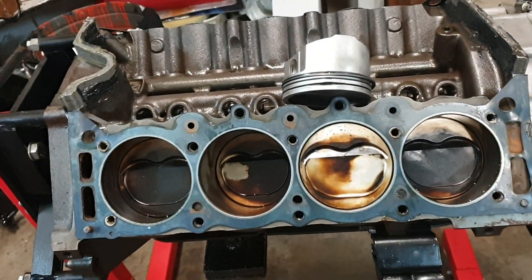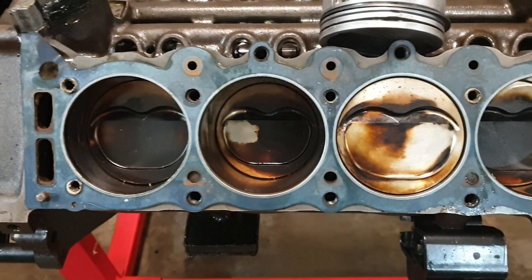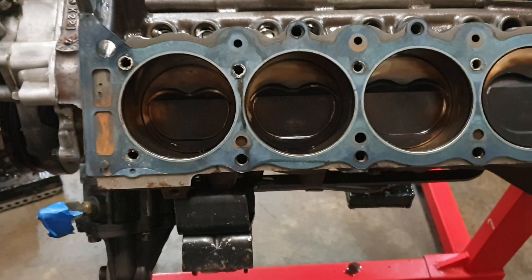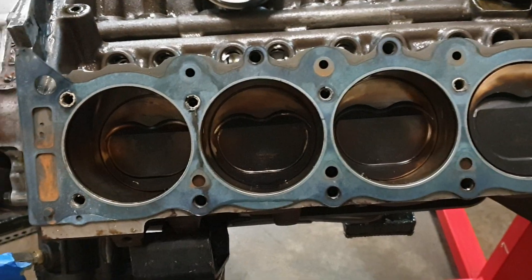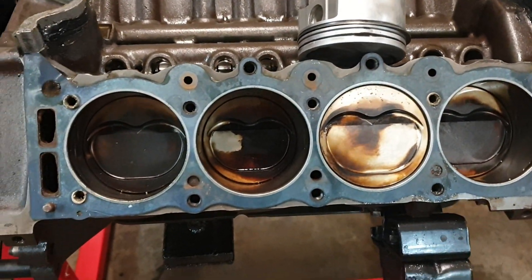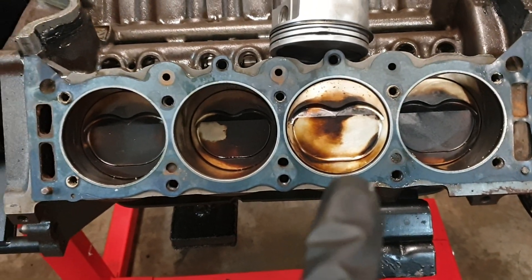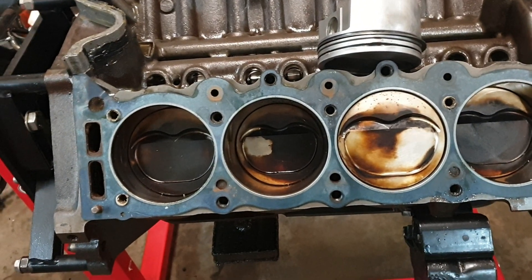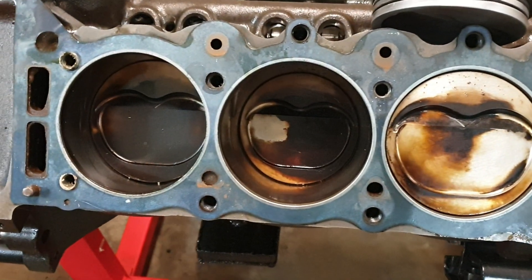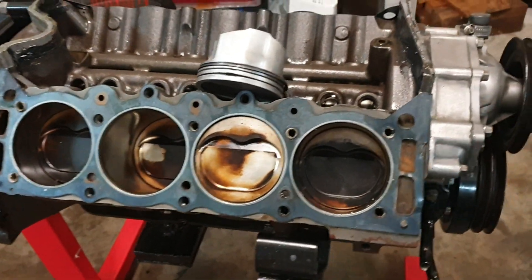I did wipe a bit of that down just to check it over, but the gaskets are in great shape — awesome shape. You give it the fuel and a lot of your problems just go away. It's plagued me for years, it really has, been a long journey. But I'm really happy with it so far, it looks fantastic. These gaskets will not hold up to any detonation — they just go. I've blown head gaskets without any detonation showing on the pistons. They just don't hold up, but if your tune's good I've always been a believer they will hold and you can make good power.